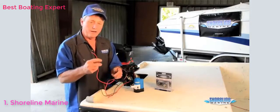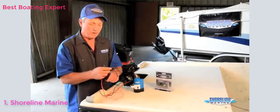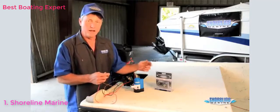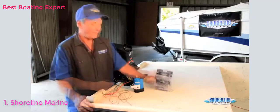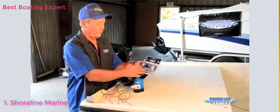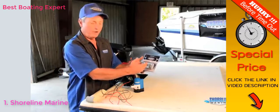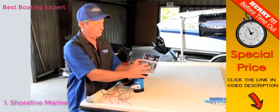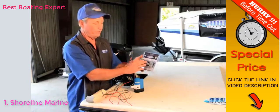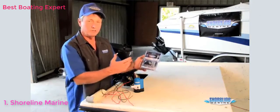Red wire will go to your battery positive or to the auto side of a switch. Black wire goes to ground. And then your brown wire will go to the manual side of your switch up on your console. If you don't have an auto switch in your boat already and you want to put one in, we have a panel that's already made up, has a three-way switch for manual, off, and auto, has a circuit breaker already in it. Have your old switch that's just a manual switch, you can take your positive off of it, hook it right to the circuit breaker, everything's wired, run your wires up to your switch, done deal.